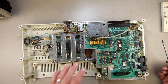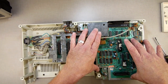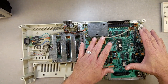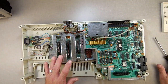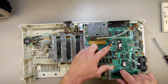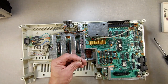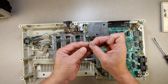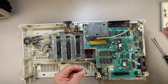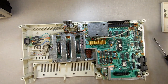If this Adam is going to be your daily driver and you use it a lot, I suggest taking these off. Now once you get in here, there are two screws holding this — this is the game board, or the ColecoVision board. This is basically a ColecoVision with a few extra chips — these four buffer chips have been added. The screws here are where short screws go. The difference between a short screw and a long screw, besides the length, is the size of the heads — the short screw has a big head, the long screw has a small head.